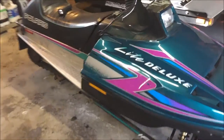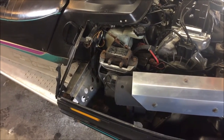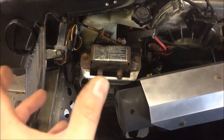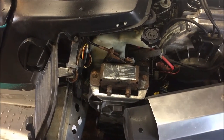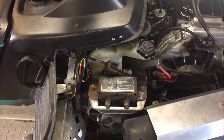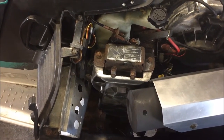The Indy Light was essentially based off the first XLT chassis, and even though it's a smaller form factor it shares a lot of components from the early XLTs — one of them being the chain case. With this particular chain case it's a simple drop-in caliper, held on by just two bolts. If you look at any mid-90s wedge chassis — whether it's an XLT, an aggressive chassis, or a Gen 2 (which is essentially an upgraded wedge with different plastics) — the chain cases are for the most part all the same. So this should be a fairly straightforward upgrade.